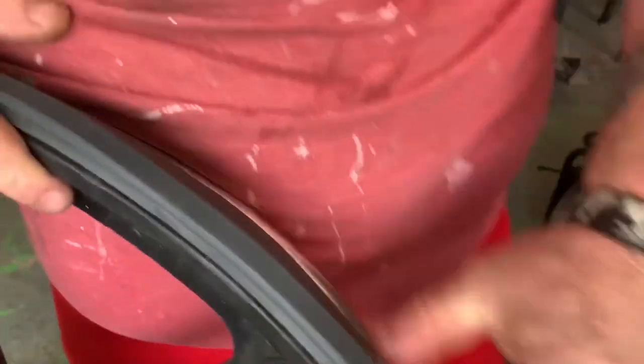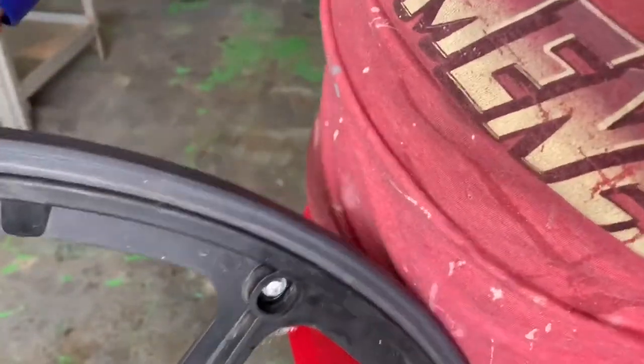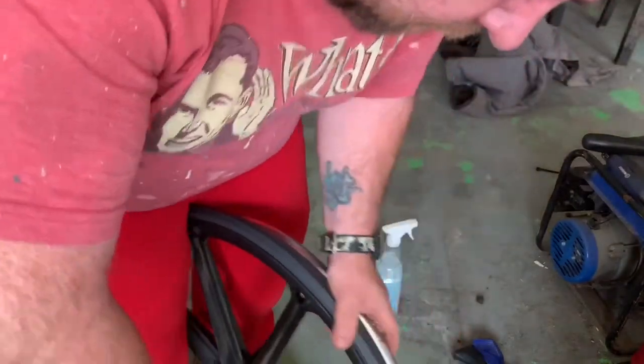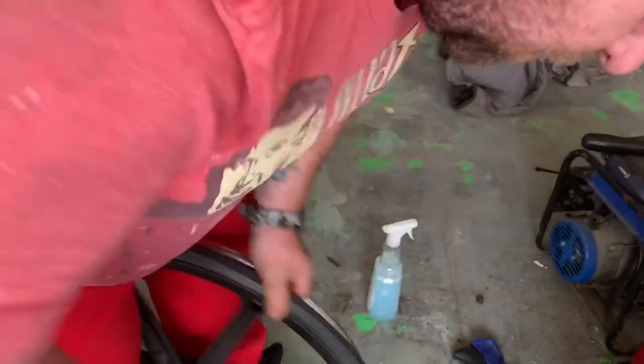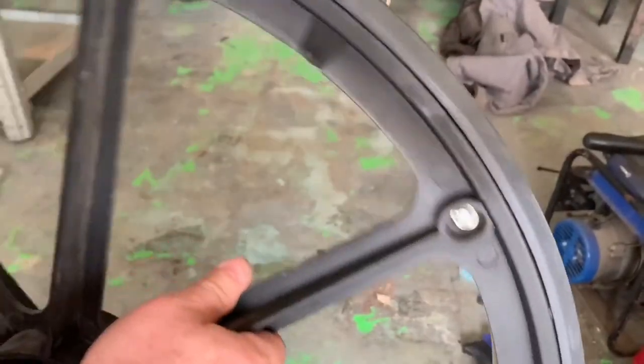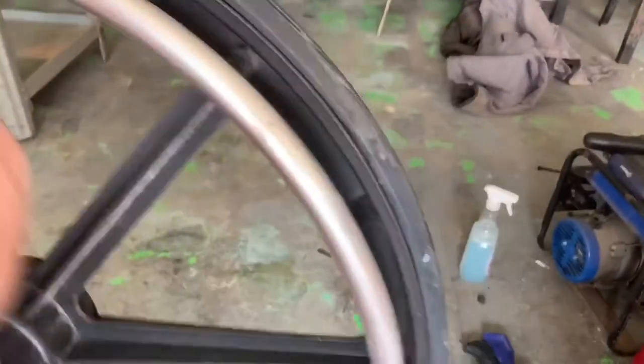But look — I finally got it to where the tire is pretty much on the rim. There are still spots where the tire was kind of turned. Where it's turned you'll have a little gap, and you can fit that pry bar in there. As you slide it around — holding it with your legs — it actually straightens the tire so you can start beating on it again to get it down inside the groove. The lubricant should help when you go to beat it on there. See, it all fit down in there. Just slap it on the ground — but don't beat it too hard because it's a plastic rim and you could break it. Also watch out for the guard thing because you can bend that as well.